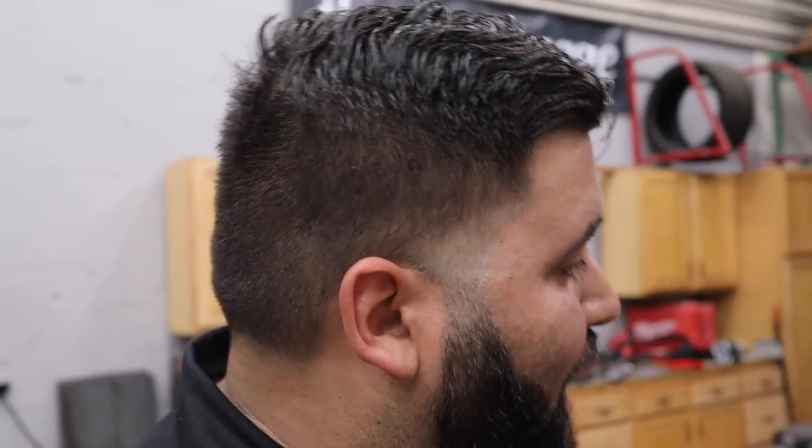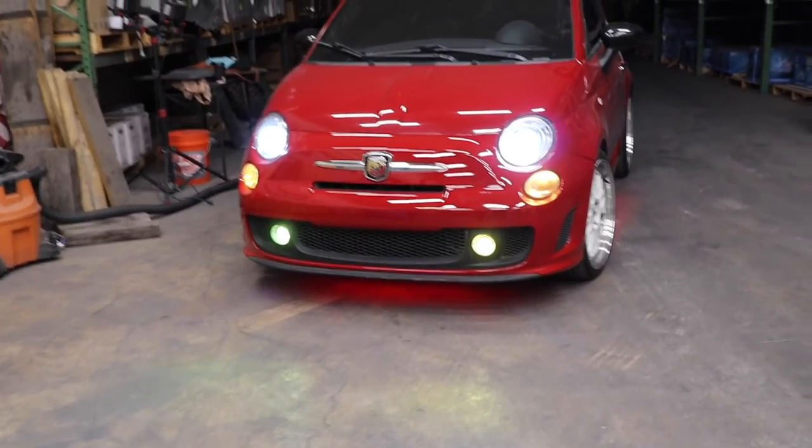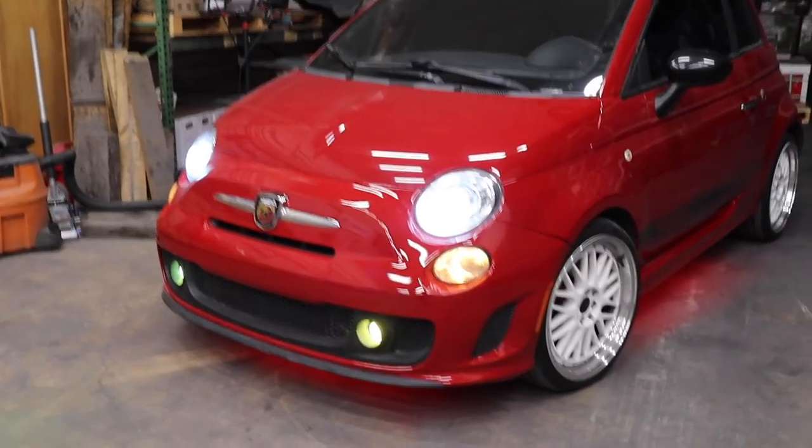Should we show the people our lighting upgrades? I ended up doing the HIDs on the Fiat. We got 6K uppers and 3K on the bottom. We're going to wrap the fog lights in yellow film along with the DRLs, just because we want them to have a deeper yellow tone. I'm not too crazy about the bulbs on the bottom — this was a cheap eBay kit and they don't match the greatest. But it's a much-needed lighting upgrade. If I'm not happy with them, I do have an extra set of 6K bulbs I can put on the bottom so the headlights and fog lights match. This thing is coming along really nice — she's all tricked out already.